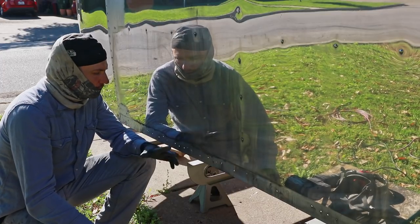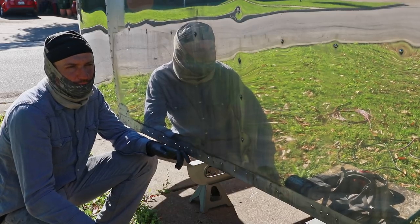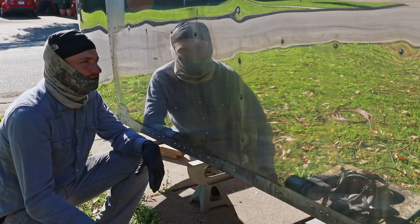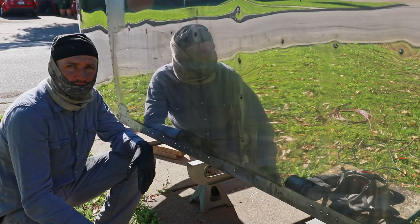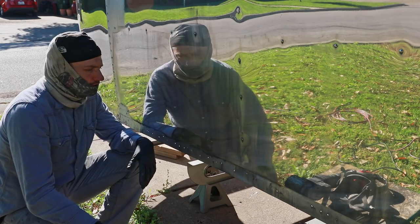And so either way, you still want to be careful. If you cut too deep, you can get into some of the deeper aluminum and it may corrode a little bit faster. Usually you want to seal it with something. I'm going to be finishing it off with a polish that has a sealant in it, so that'll definitely help avoid corrosion. Also, continually keeping it upkept and polished prevents corrosion. So doing a maintenance polish about once a year will prevent that as well.